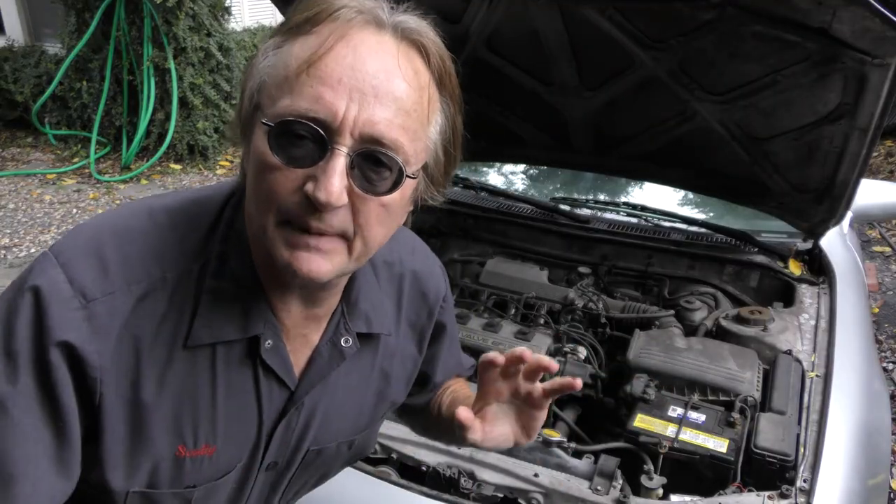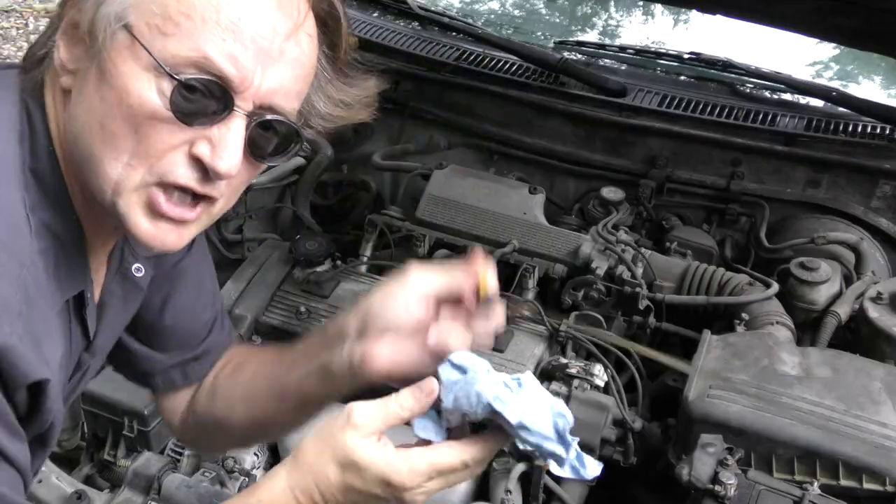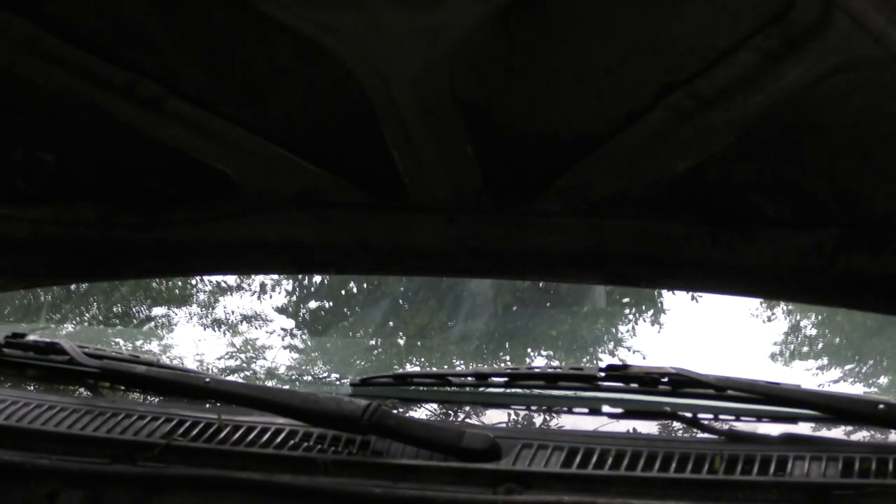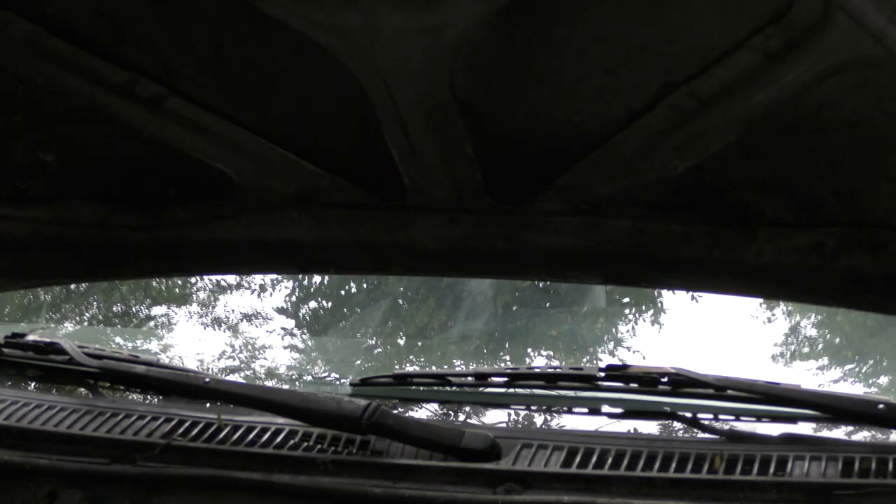You want to see if the engine or transmission got water in it first. Check the oil dipstick — in this case it's clean and right at the full line. If it had been way over the full line, that means water got inside and displaced the oil. Because if there is water in the engine and you start it, it mixes up and destroys things. But if you don't start it, you just drain it all out and change the oil and filter, and it can be okay.